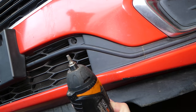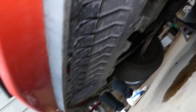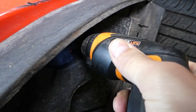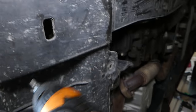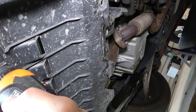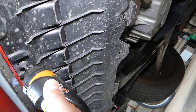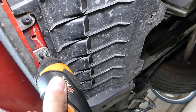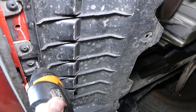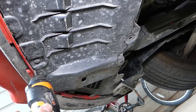I'm going under the car now. We're going to need a Torx T20 star bit. You can see this cover here — this is the cover for the bumper. Once I remove the bolts I'll be able to show you exactly where it is. There's one screw here, one more next to it, and then we need to get this one here and one more on this side.